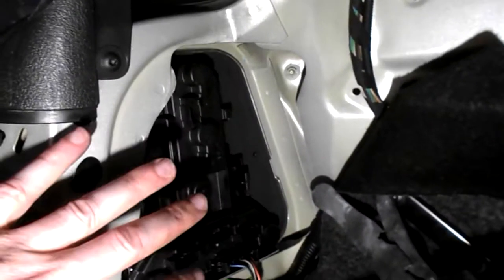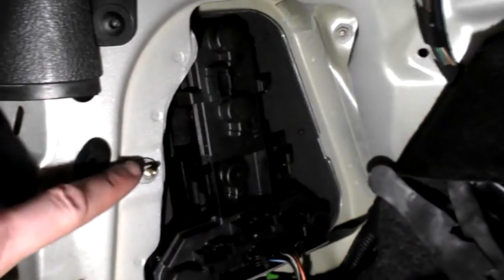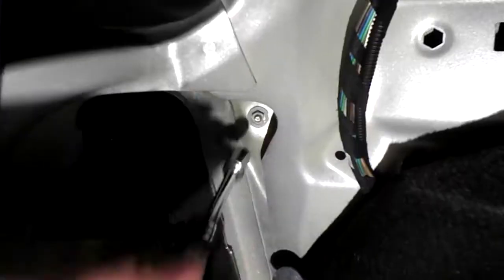Let's open this panel up. That's the back of the light unit. I've just removed the trim work — you don't need to do this with all these carpet bits here, but it makes it easier to show. You've got one nut here that you need to remove and another in the corner. These are 8 millimeter.